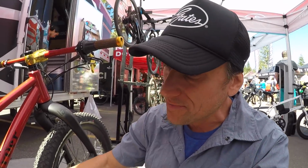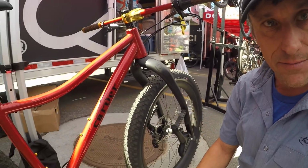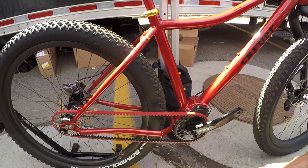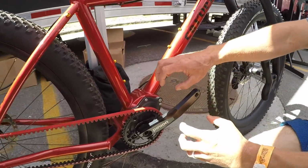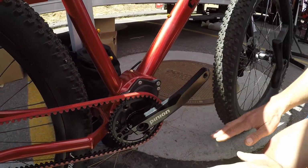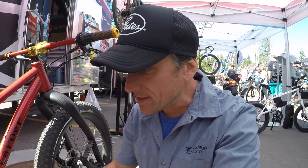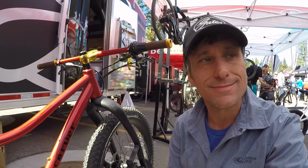One of the advantages, especially for mountain biking, where maybe you're going off some jumps, is that an internally geared hub in the rear wheel might throw off the balance of your bike a little bit. Sure. So with the Pinion Gearbox, you're centering it low, center of gravity. It really brings a nice stability to your ride, and it's a nice stable platform right there between your feet. Yeah, this is wonderful, man. I don't know if we've hit everything.